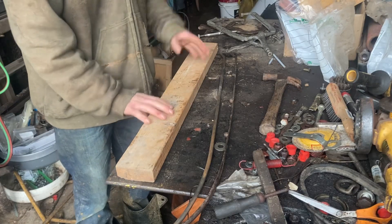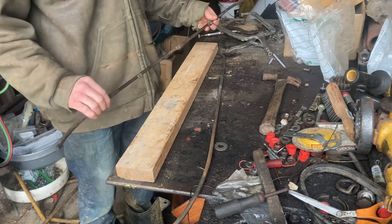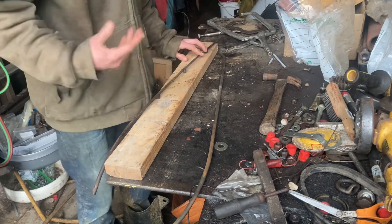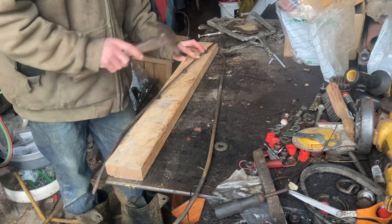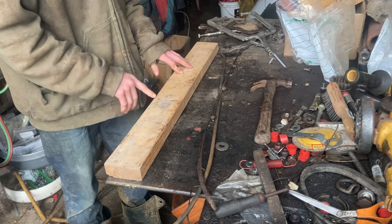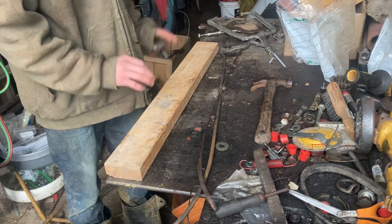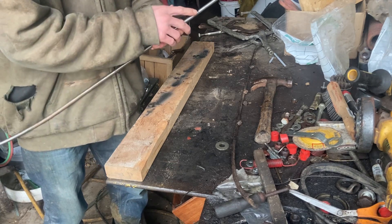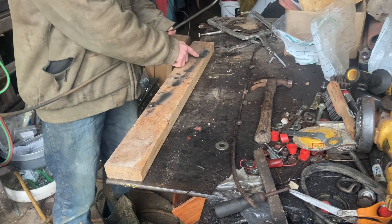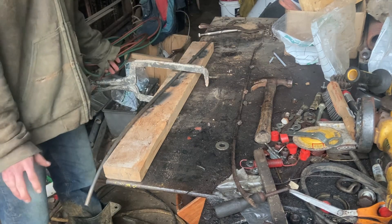Now that it's time to put our studs in, I found the best way is to make a jig. I've got this 2x4 and I take my old rod and set it on here at an angle so I can fit more patterns on this piece of wood. Hammering them in makes a little impression in the wood. Then we go over to the drill press and drill these out using a 5/16th drill bit — the bolt will just sit right in there and the spacing will be all good. Here's the mark on our rear rod that goes right in the center of this bolt, and we just need to make sure this is centered on the rod, then clamp it down, making sure the rear rod and bends are perfectly straight up and down.